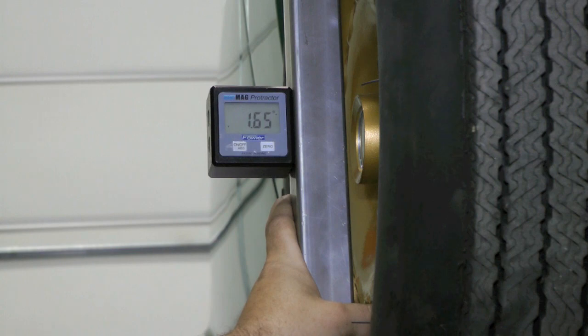As you can see from our digital mini mag, we're at 1.65 negative degrees of camber. So I'm going to adjust it and bring it in to about one, maybe one and a quarter at the most. We're just going to get it close for now and fine tune it later. The point is, this is just an exercise to show you how to adjust the camber on the car - you really can't do it by sight. The steel beam resting up against the rim we've confirmed is completely square, cut to fit just inside the bead of the rim so it doesn't have a lot of room to move around. Our tool works very effectively.